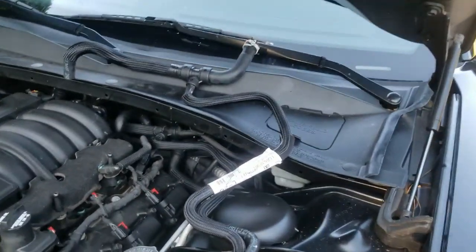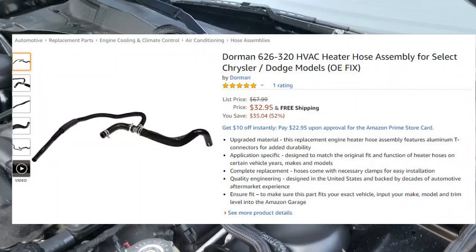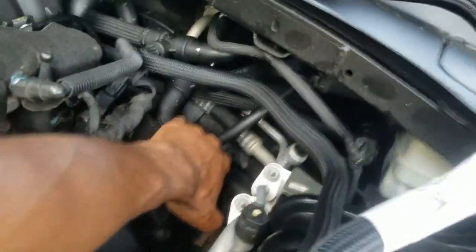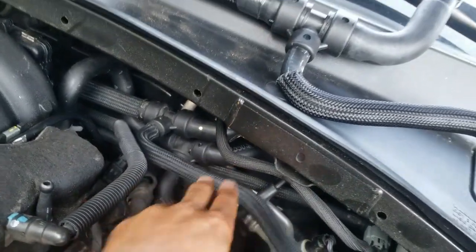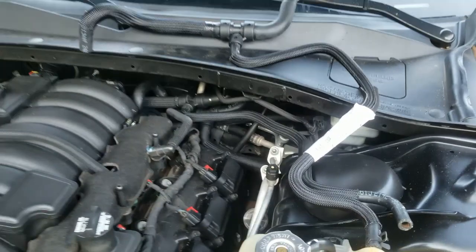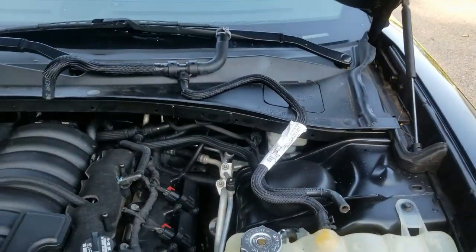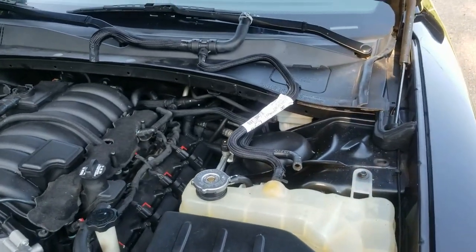Got the part here — I think the part number is 626320-something. There are two of them: one is right down here, and that second one isn't leaking because the leak was coming from above. The bottom one is part number 626319. Nobody had it, so I ended up having to get the part from the dealership.